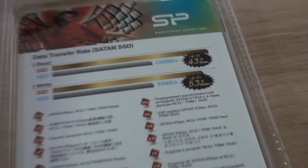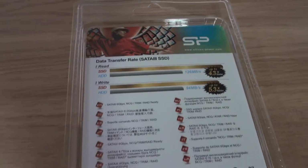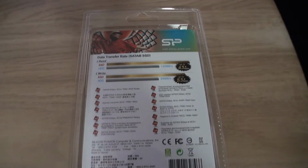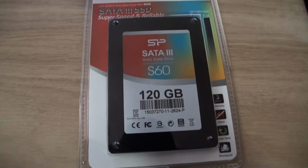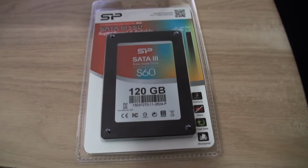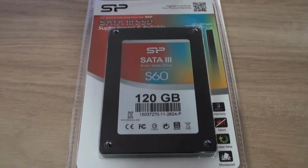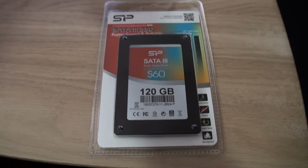First we're going to plug it in, install it and set it up. One thing to note, if you're not familiar with setting up internal hard drives, is that when you plug it in, it will not show up on your computer as a hard drive. It will not recognize that it even exists until you initialize it. You have to initialize it. So we will walk you through that and show you what to do.